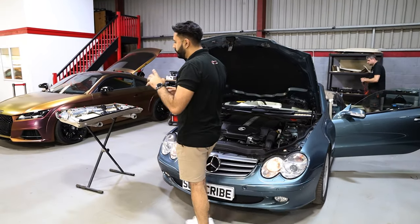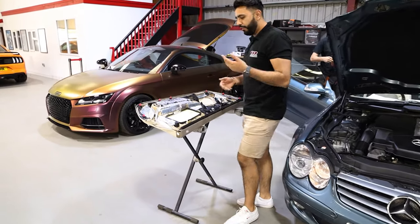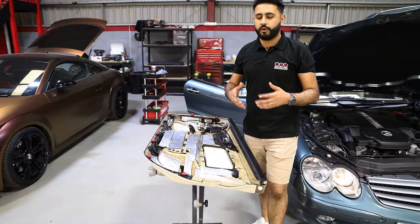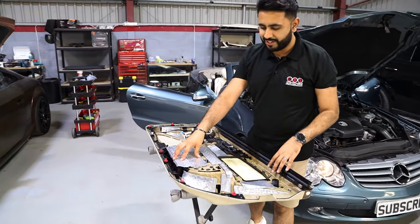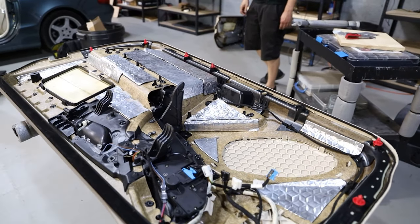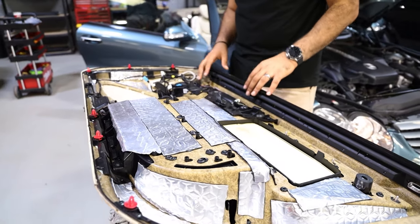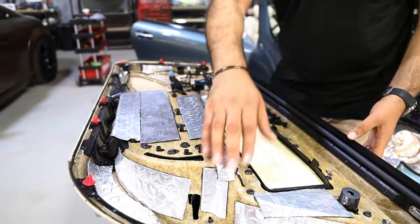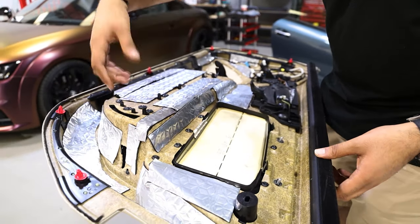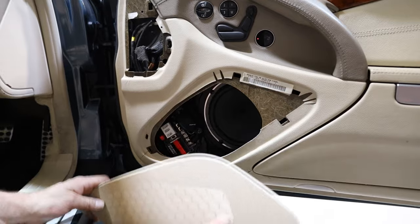To start off with, we touched on it in the previous video — soundproofing. You've heard us talk about it in plenty of videos before; it's a very important part of any installation. Basically this is a Skins 3mm layer acoustically treating all key areas of a door card, making it a far better acoustic environment for the new sound system. The plastic clips have a little bit of movement, so these will all be taped and secured, ready to go back onto the vehicle so everything is far more solid.